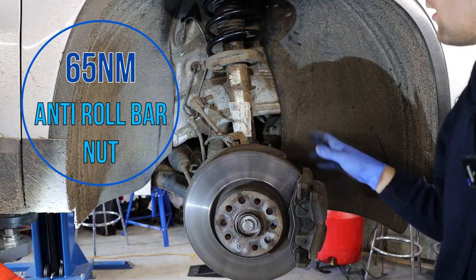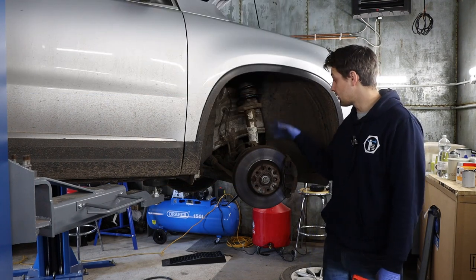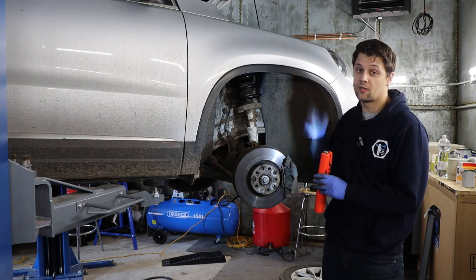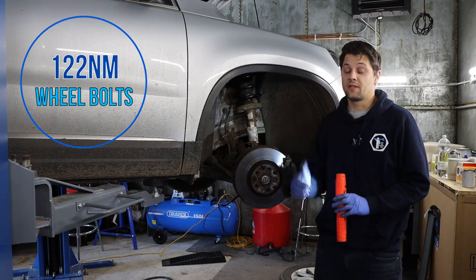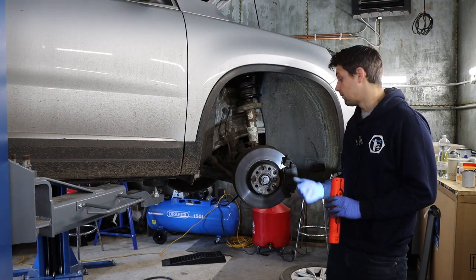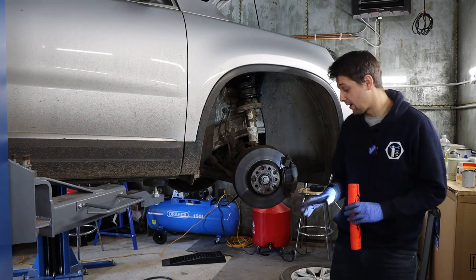At this stage you're pretty much done. Anti-roll bar link is done up, the bracket is on, the bolt through the hub to hold the shock is on and safe, the three bolts at the top are done up, and the nut on the top mount is done up to the correct torque. All torque specs for all of this will be in the description below, along with all the tools I've used. The spring compressor worked well, and the lower arm bar tool was the day-saver — it saved us from having to take the drive shaft out, which often seizes up in the hub and would be a massive pain.